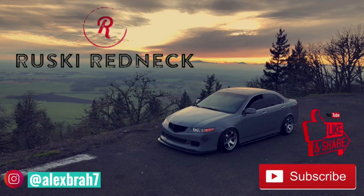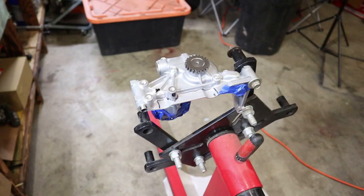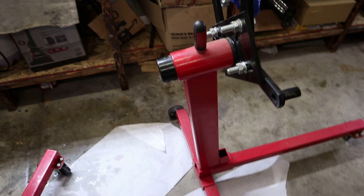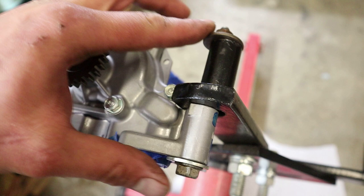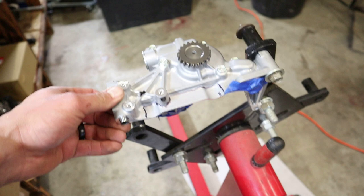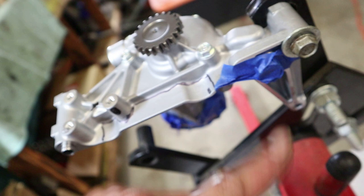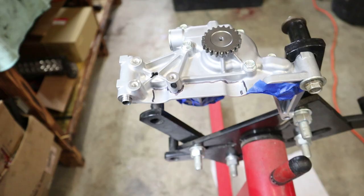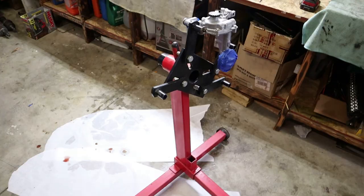All these tools I've got in my shop, the one thing I don't have is a vise. But I've got another engine stand, so I ran one bolt through right here, a couple washers, and just bolted it down. It's fairly snug and it's not going to fall over. I taped up the oil passages and the suction end — after we're done, before we take that tape off, we're probably going to want to blow this out and make sure we get any aluminum shavings out before installation. Make sure you're not cutting near your open motor — I got it wrapped up and moved it away.